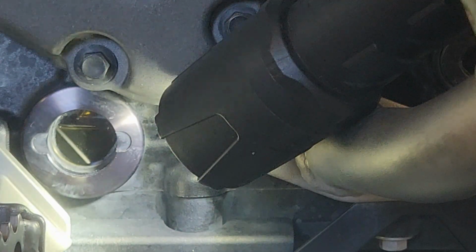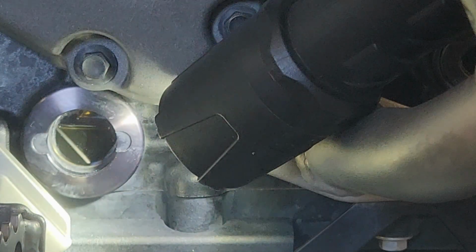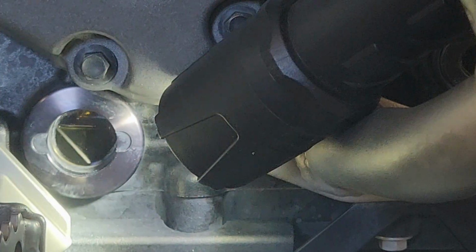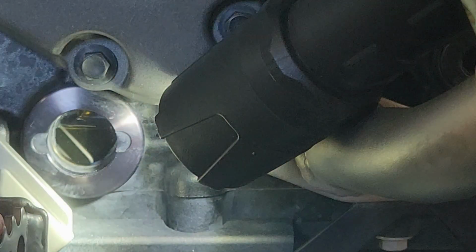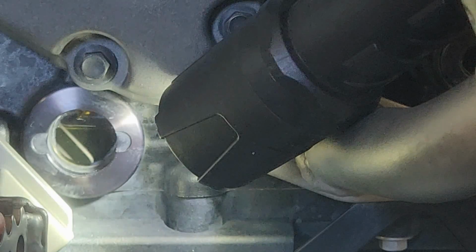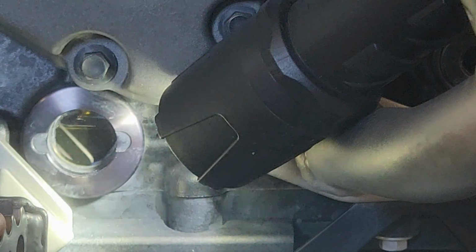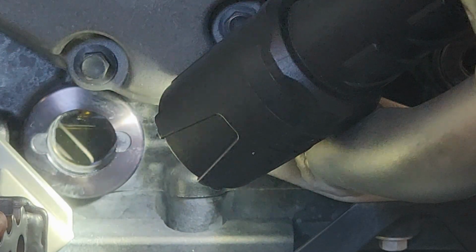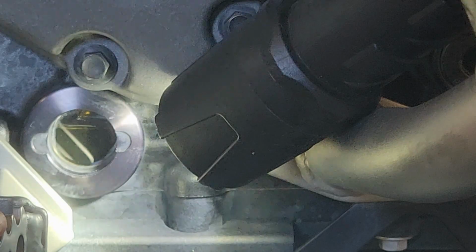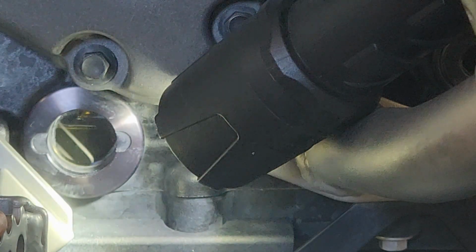Okay, there we go. I got the oil in, and it's at the right level. It's at the top of that moon. This little shape right here, so it's up the top of that. I did notice that when I was putting it in, oil was dripping out of the filter housing, but I think that's part of the process. It somehow pushes the dirty oil out of something inside the engine there, so that's why they have you leave that off while you're filling. So there you go, that's filled up.